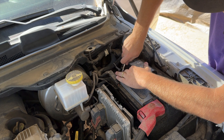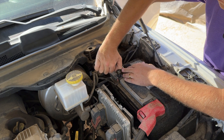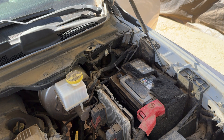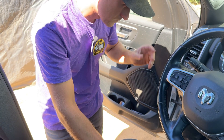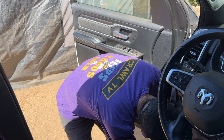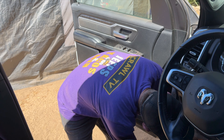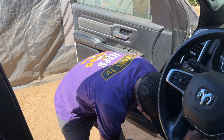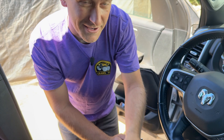We're not really doing anything that requires disconnecting the battery, but it's a good safety measure so we don't throw any weird check engine codes during this process. With the battery disconnected, it's now time to dig in. We're going to start with a seven millimeter socket on our little ratchet and remove these two seven millimeter screws at the bottom of our dash. When you take these out, set them somewhere you won't lose them.